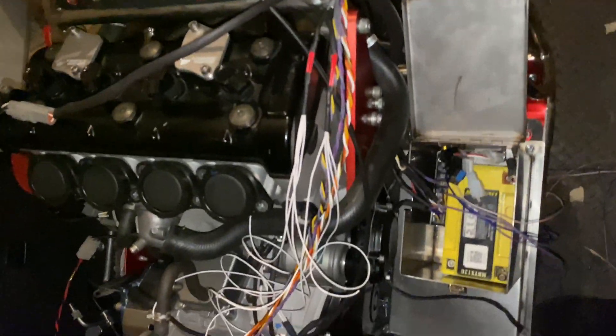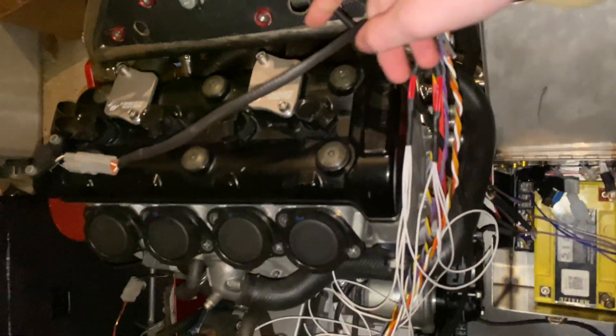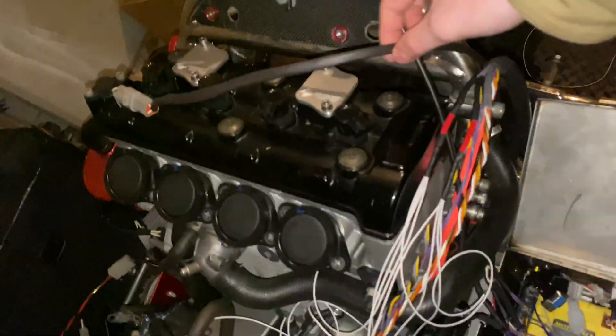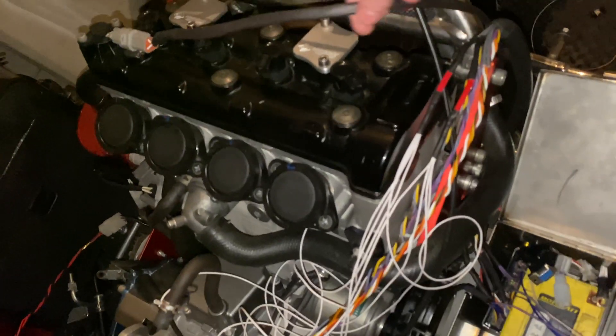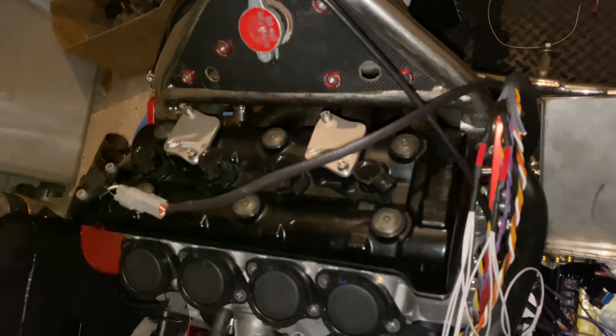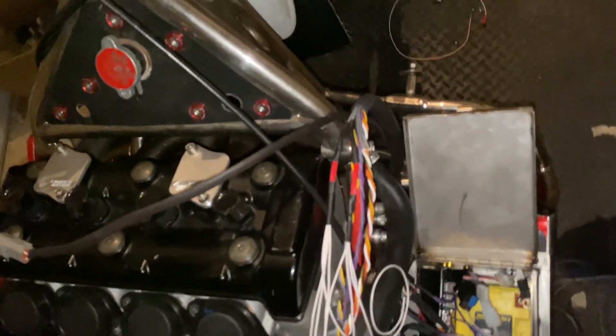You join me part way through where I have already wired in the camshaft sensor and the crankshaft position sensor. The camshaft sensor, running alongside high frequency outputs for quite a long period of time, has been wrapped in a metal braid to help reduce induced current, which can interrupt the signal and cause misfires at high RPM — obviously something we don't want.